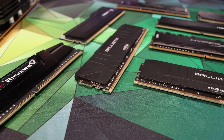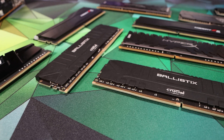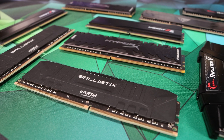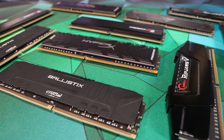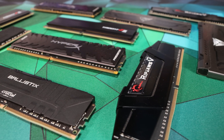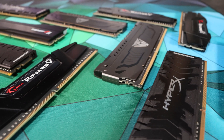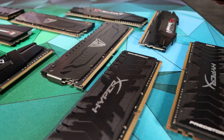If you want to find out more about the power limit issues with this motherboard, we'd recommend checking out our linked video which goes into much more depth. In terms of RAM performance, we ran both 3600MHz CL16 and 3200MHz CL16 kits at both 16GB and 32GB. We had no problems whatsoever running those kits at XMP speeds and we think this board will operate absolutely fine with the vast majority of DDR4 RAM you care to pair with it.